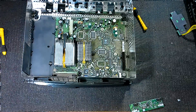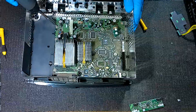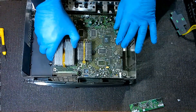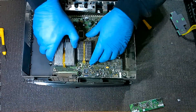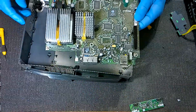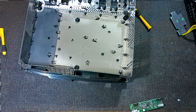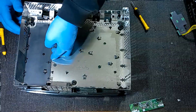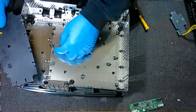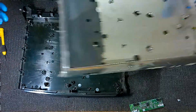Now we just have the motherboard. We're going to take out a bunch of screws — depending on your version, these will be placed a little bit differently, so be careful and make sure you get each and every one. Now we can just start pulling upwards. Your one issue is you've got a little post you have to lift up over, and then you've got to wiggle the AV port out and slide it out. Now our motherboard's out, and that's pretty much the full disassembly. If you want to remove this one last piece — I think all but one version has this — there's a little bit of adhesive holding it, so pull that first and then you can easily slide it off, and you're left with just the case.